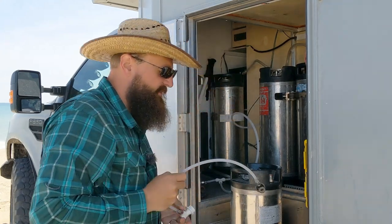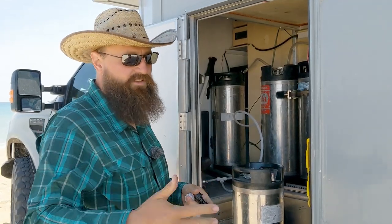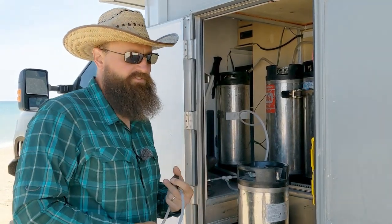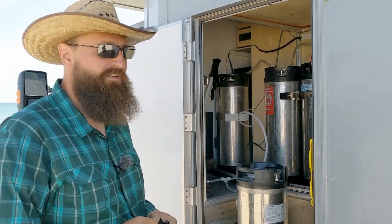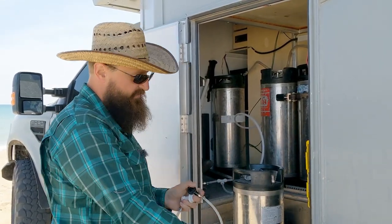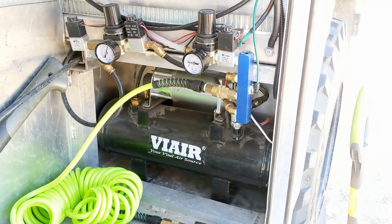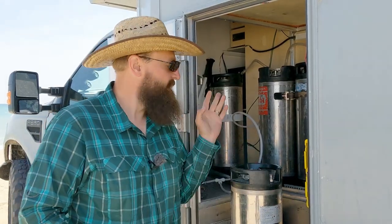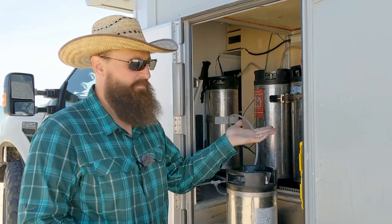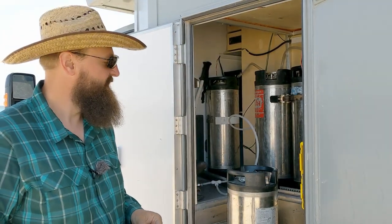With five kegs, I've made a few jumpers that allow me to daisy-chain them so one feeds the next. We usually have four wired in series and keep one as a reserve, so when we're out of the four we know we have just that 20 liters left to be mindful of water usage. The compressor is pretty simple — the air compressor is tucked in this compartment, goes through the air regulator down to 40 PSI, and from there it heads through the living area through our water filter, which I'll show you next.